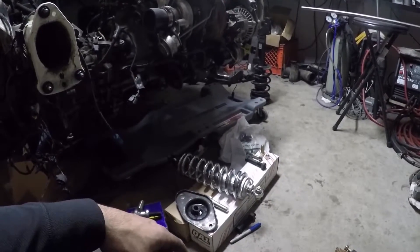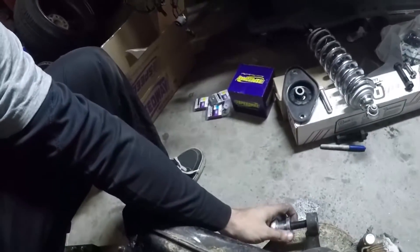The shock does fit really well, but I think there's one part we might have to shave down on the sway bar. It should clear the axle and the swedge tubes. We did have to use the spacer again on the top to get extra space — it clears the axle without the spacer, but when we add that one inch spacer it gives us a lot more clearance on the coilover so we don't have to chop the entire sway bar out, instead we can just shave the mount a little bit. It's like three in the morning right now so I'm pretty tired.